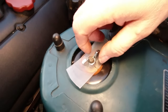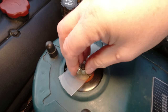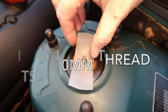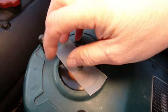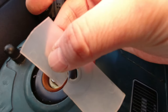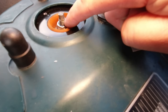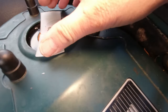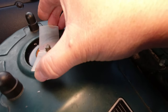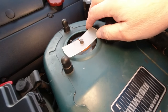Just to show you what this is all about - wing nut off. You can use a normal nut, I just like wing nuts. We've got this plastic strip which is a little bit snug on the thread so it's easy to unscrew and pull off. I've radiused the ends to match the curve inside the cover. There is some exposed thread still down here, and the strip is curved because where it pulls down to is below the surface, so the ends will naturally sit up - which is exactly how you need it. It does no damage to your car, won't fall off, and is quick and easy to reverse.